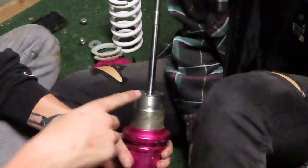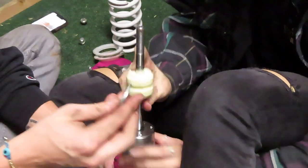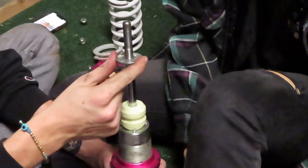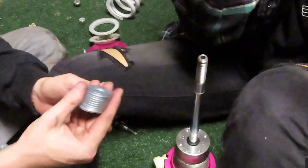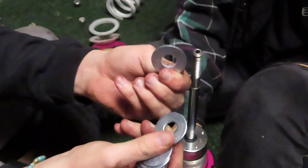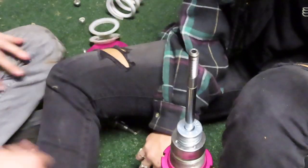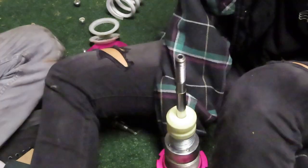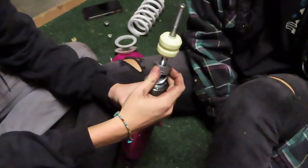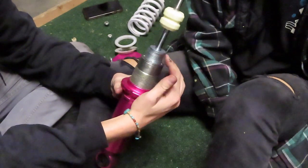So what we're going to do is put the washers below the bump stop, then put the bump stop back on. One thing we're going to make sure to do is put this washer back right there, because that's what the top hat sits on. Next, you're going to count out all your washers — we're doing 10 — and you want to make sure they're all facing the same way. So 10 washers on, and then we're also going to be using the bump stop. Now we put the coil back together. Since we're doing this on coilovers, we're not going to have to add or remove washers, so you're going to err on the lesser amount of washers.